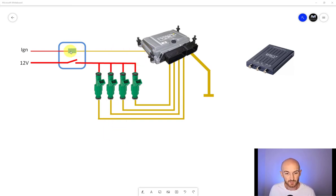So why is this so important? On screen we've got an image of a conventional injector electrical setup. We've got the engine control unit, a power relay, and four injectors with a constant power supply grounded by the ECU. As long as the ignition is switched on and the ECU has grounded out the control for the relay, the relay will close, giving a constant 12 volt supply to all four injectors. Inside the ECU there's a switch for each individual injector. That's important to know when measuring these injectors, especially with something like the 2204A.